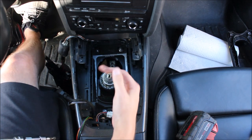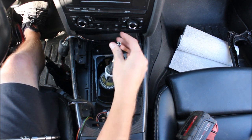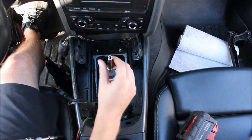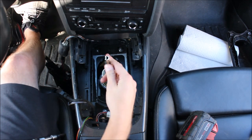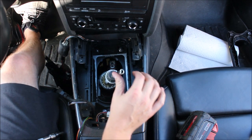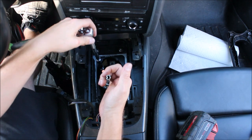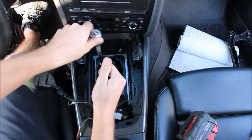Now I've got my left and right dialed in — need to check my fore-aft. It actually seems not bad right now. I can get into all the gears. You should feel that you kind of firmly get into the gears and it settles a little bit past — you can feel a springiness where pushing forward at a certain point it takes over and pops you into the gear. The ones on the edges — first, fifth, and sixth — are a little more of a stretch. If I don't feel like my engagement going to the front is good enough, that means I need to move the shifter back. Fourth gear is awesome because you get great access to this bolt.